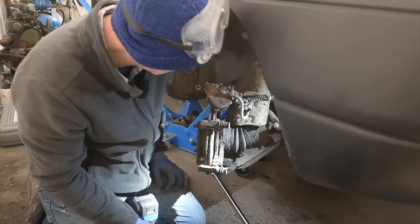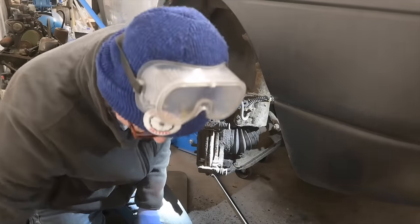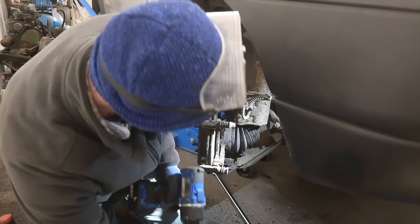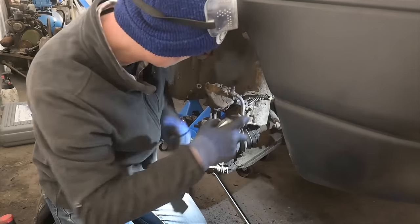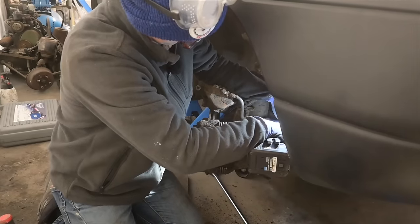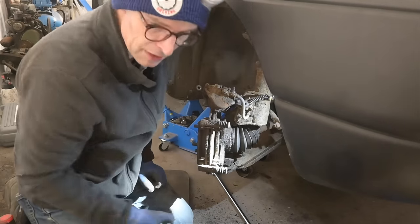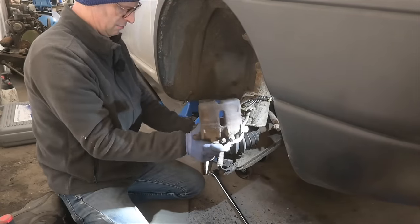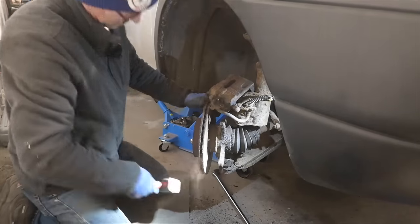Oh good, it's rounding it — that's what I'd like to find. Do I have a 14 I can hammer on there? No, that's too tight still. Oh I hate this car. Right, I've got these super grippy multi-drive things from Draper which will fit on there. I'm hoping with that wedged on there I might better free this thing off. It looks like it's been in the bottom of the sea, and there was Loctite thread seal on these things as well. So I'm going to have to buy a new one of those bolts, and a new caliper carrier bolt as well — but that does mean the disc can come away. Why won't the disc come away? It's held on by dirt as far as I can tell. Hammer. Come on you so-and-so.